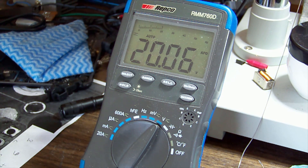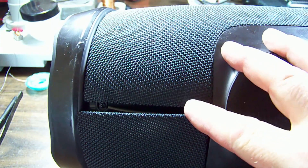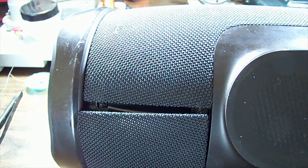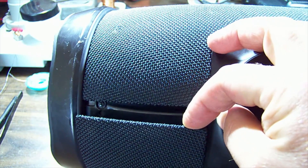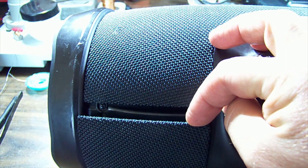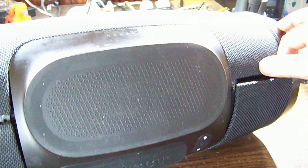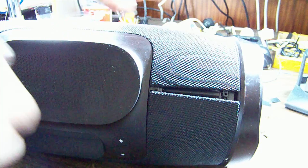The unit must be turned upside down. We have a seam, kind of like on the portable units - the smaller coke-can size units. Just pry in there and we see one side comes up, and there are a couple of screws holding the other top edge down, so get those out and repeat on side B.